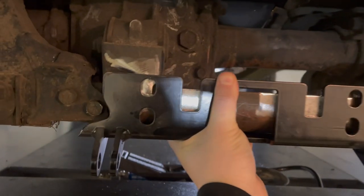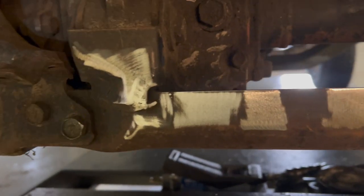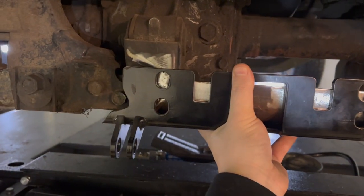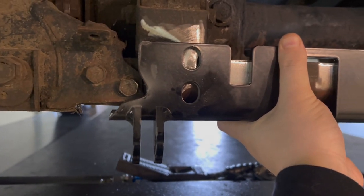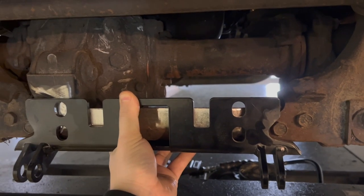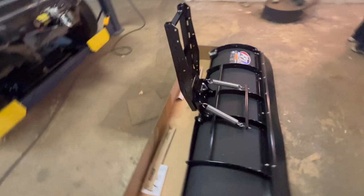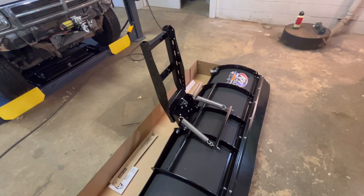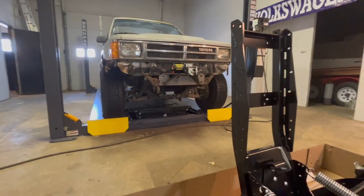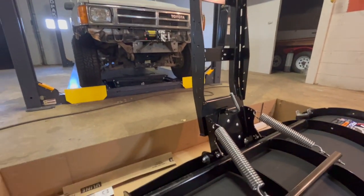I got the mount cut down to clear the bolts that hold this cross member on. This cross member is kind of acting as a front diff mount and sort of a brace between the lower control arms, so I have to keep these bolts accessible in case I want to take the front diff out. I nipped the ends off so I can fit a 17mm socket in there and the bolt can come through. I'm going to weld this thing on. We got the plow all assembled and I got the mount stuck on with some not-so-great welds — soon enough they'll be together.